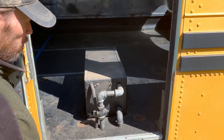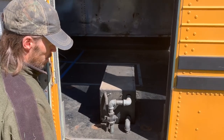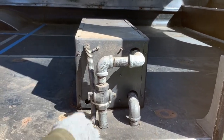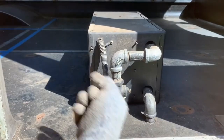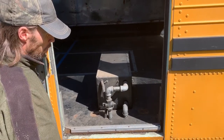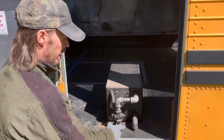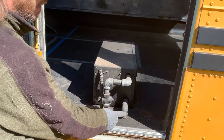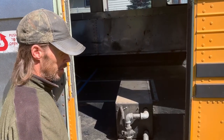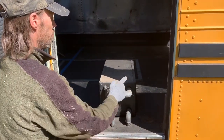Will the system be enclosed, or how does that work? Because what does this thing do? This is a heater core, so the engine coolant circulates. It comes from the engine and circulates through the heater and back either to the front heater or back to the radiator. Okay. So that system has to keep operating. You can't just trash it. I was trying to figure out, can you just take these off and then cap them? But it'll be just as easy to basically hook the hoses together underneath so the water can circulate, just like it has been through here, only it'll bypass that heater.